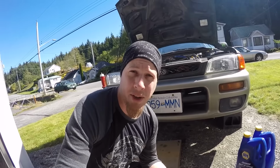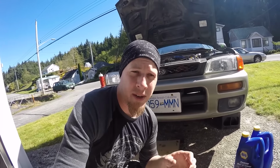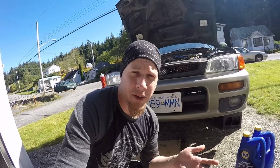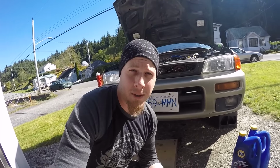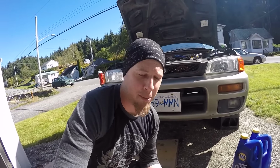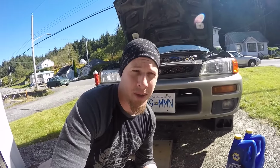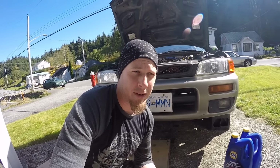What happens is the material circulates with the oil, and even though it's broken down to very fine particles, it'll build up on the bearings, and that excessive material on the bearings eventually causes issues, and not necessarily contact with the crank, but if more material starts to build up in the same area, you start to get lines in the bearing and lines in the journal of the crank, and basically that's when bad things start to happen. So you want to keep your oil as clean as possible, obviously, and putting together any mismatched engine or something that you've had apart and back together, it's good to initially change the oil after so many kilometers or miles, just to get all that crud and dirt and broken down metal material back out of it, more or less a flush.